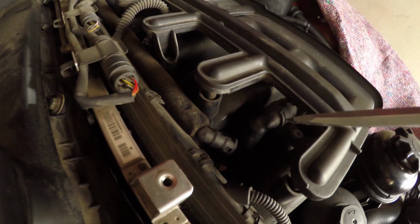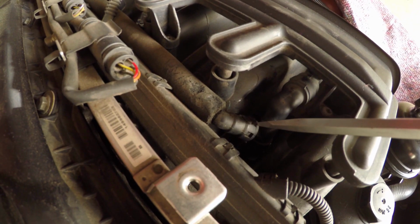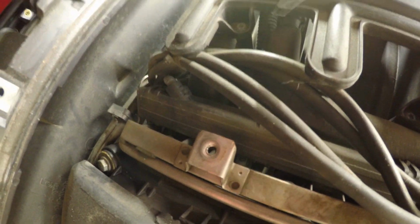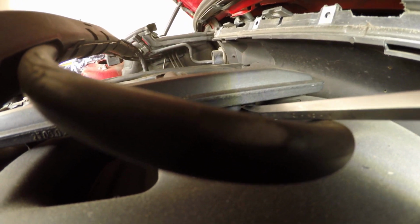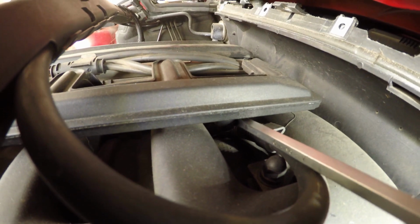They're now out. In order to get this elbow out, I have to disconnect this pipe, but this pipe runs the whole way to the back of the manifold and runs in here. So to get that out, we have to go to the other side. So this is the pipe clip. I need to break as I just cannot see past the camera now. So let me get that done and let's look at it after together.